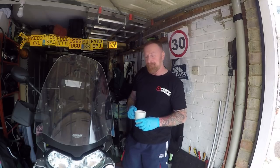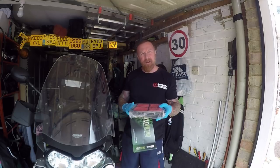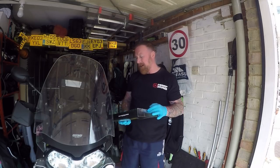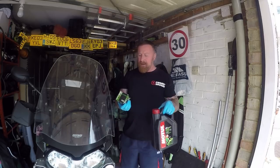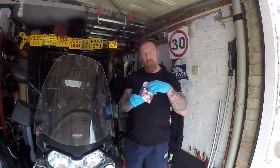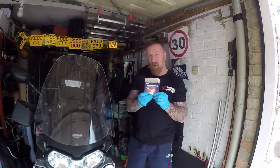Tiger Triumph 800 — this little baby. What are we doing today? A high flow air filter. I looked at the K&N one; to be honest it looks pretty much the same. Probably not washable but a fraction of the price, and it'll still do 4,000 miles — job done. So we're doing the filter today. Oil — your choice; I go for semi-synthetic. And another high flow filter again. This is the old HF204, pretty standard. But I have gone for iridium plugs — a little bit better burn, a bit more power. They last longer as well.